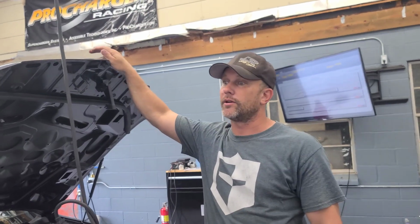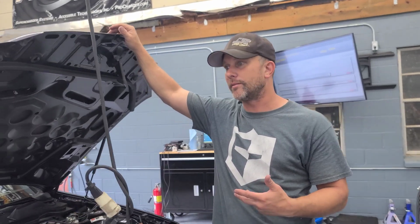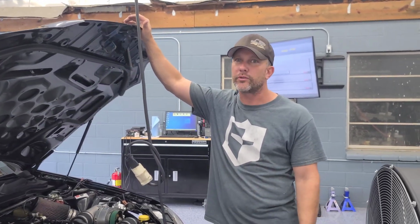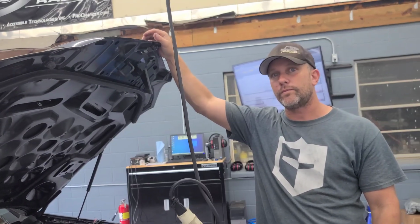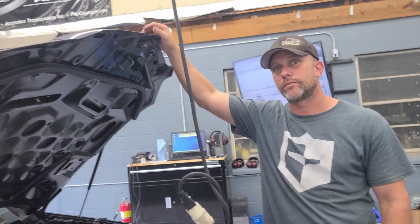Huge. Because we can get by with a stock in-tank and a DSX aux with a 320 pump, and on the 85 now, that'll get you 700 pretty reliably. Once you start getting over 700, things go downhill pretty fast. Really fast. Especially on a G8 where you don't have the 80 PSI mechanical. Yeah, you do the SS, you can get away with a little bit more. So there's that big gap between the 1,000 horsepower people and the 700 horsepower.